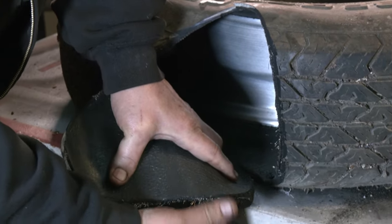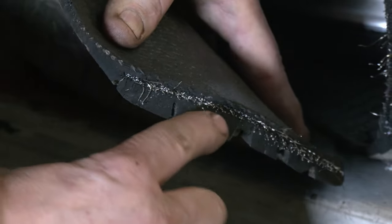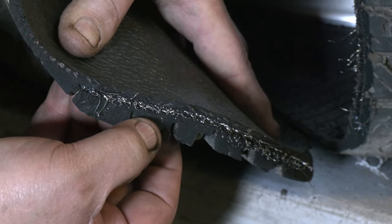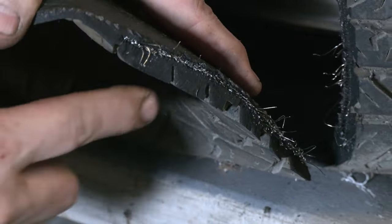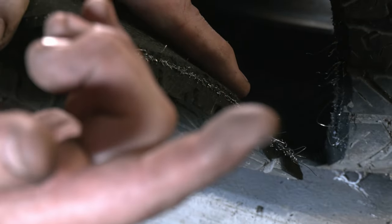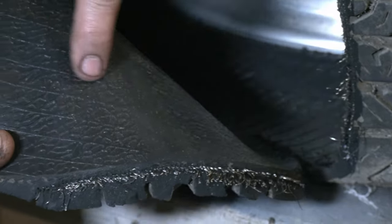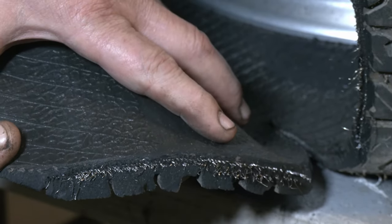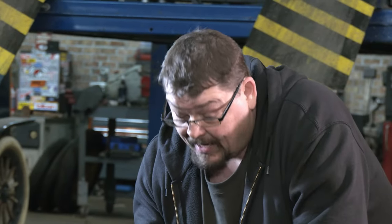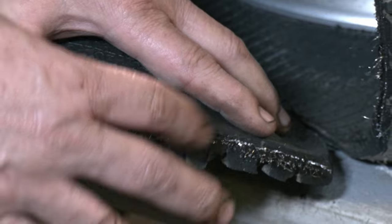Now you can see inside there, you can see the metal. That metal is cast inside that tire. That's the tread — that's the thick part. And this is the inside layer. See how thin that rubber is on the inside versus the steel cord on the outside. That's what makes the outside of the rubber watertight. But that's why when you get moisture on the inside, there are little pores in there — that moisture will get into the wire rope and rust it right out. Expensive tires have stainless steel, so they're less inclined to have this problem and less prone to water damage. That's why they always say buy the best tires you can afford.